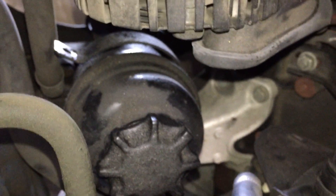It has a 10 millimeter bolt which I already took out, and I just kind of pull the bracket like that so this thing can come up. But before doing that, I'm gonna drain the fluid right here with the syringe, and then I'm gonna show you right here on the bottom how bad this thing is leaking the power steering fluid — you can see right there.